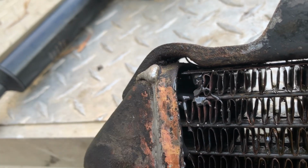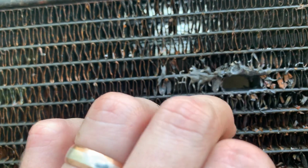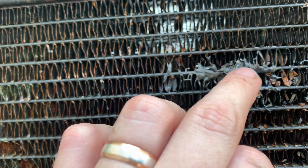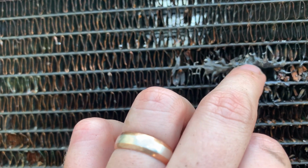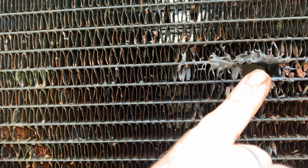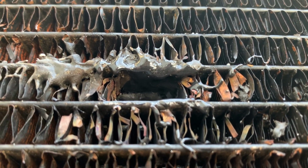So I got up in there and plugged that full of JB Weld, and then came down here and opened this up where I could get in here and see. Right in the middle, about midway down in that tube, this one right here, between these two, it was leaking. So I cleaned it up and put JB Weld on it. In there, you can see it in there. I'm hoping that'll seal that. And for good measure, I put some on that tube as well.